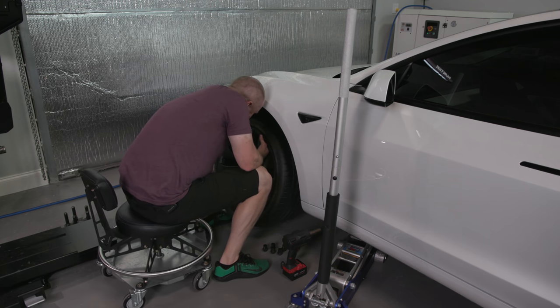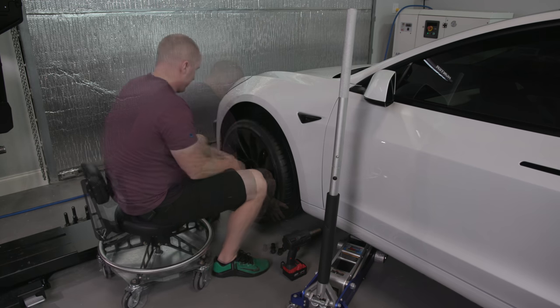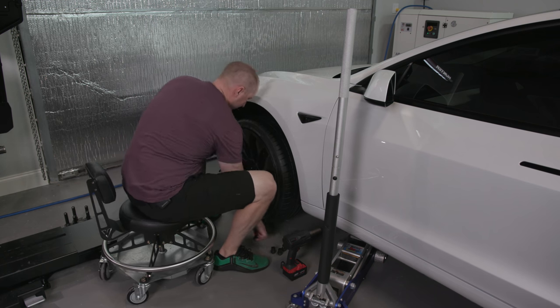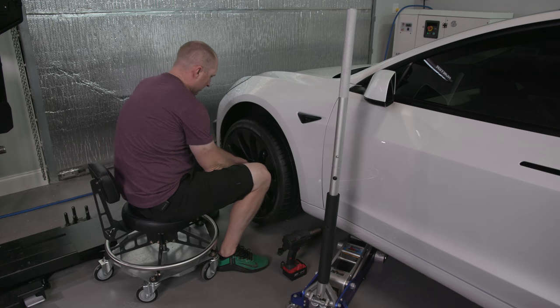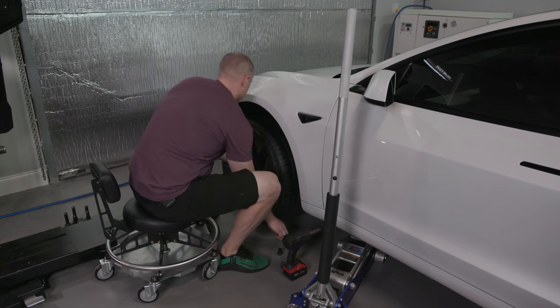Up a little high. There we go. So, not too bad. I did this wheel without any damage. I was able to figure out how to force match it better, and do it a little bit more efficiently using the preset TPMS area. Getting the bead to seat was actually a lot easier than I thought it would be in these.